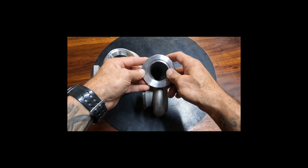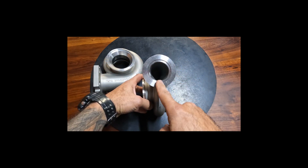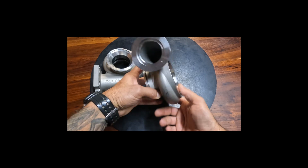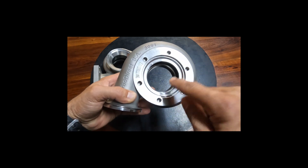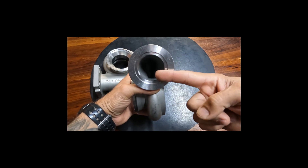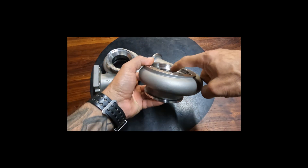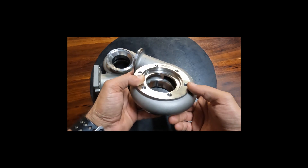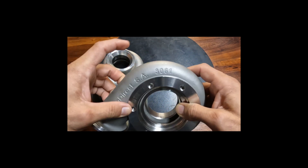We've made changes to the internal structure of the turbine housing. This is a 100% symmetrical volute — if you slice it down the middle from top to bottom, the left and right are mirror images of one another. We also have a blind hole design, so none of the holes that hold your bearing housing into the turbine housing are drilled through — you will not have any fasteners protruding into the gas path. We also have a proprietary design on our tongue, as shown in the other video. All of these turbine housings are serialized — this one is the 30 family, AR61.